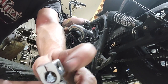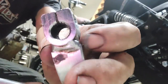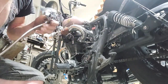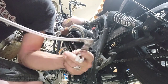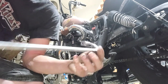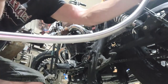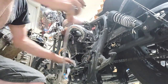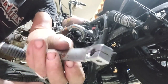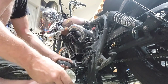That's just an extra shifter arm I had. I can't find my original foot shifter right now — it's on the bike somewhere. Now you can actually use, I believe, the same splined piece that goes on your rear drum brake — I believe it's the same splines. You can get one off of one of those if you have it laying around. It's a somewhat common piece on older Japanese bikes — probably various Yamahas, possibly Suzukis, Kawasakis, and Hondas, but don't quote me on that. Then you bend it to the shape you like.